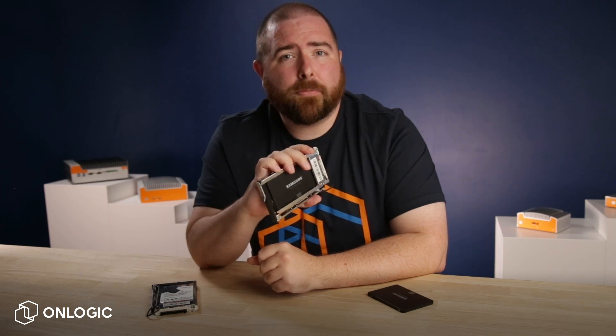It's a simple solution to what is ultimately a simple challenge, but if you didn't know there were different hot swap drive bays, you could easily chase the problem for a long time without ever landing on the fix. Because of the flexible nature of SATA drives, hot swappable HDDs or SSDs are a great option for a huge range of applications. But as with any hardware feature, it's important to understand the limitations and potential stumbling blocks.